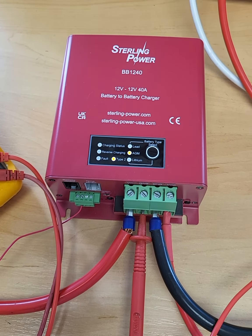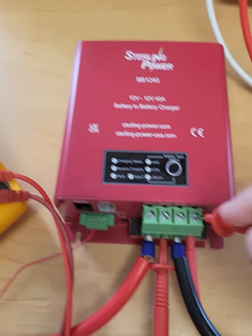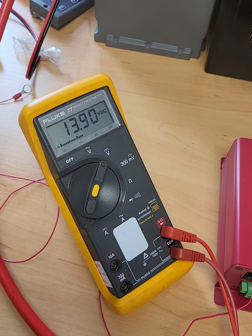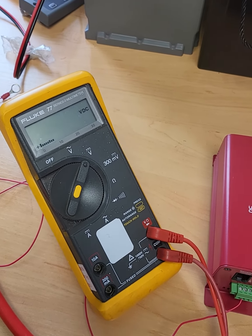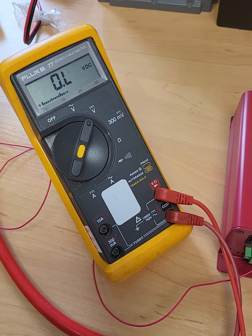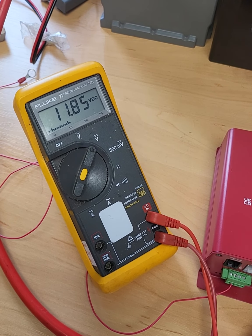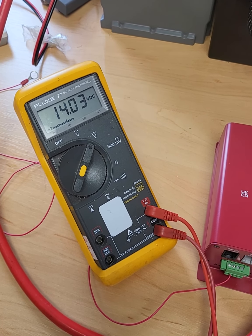Now what I'm going to do is show you what the leisure battery voltage is, which is 13.6V. If I then turn on, say, solar power or wind or something onto my leisure battery, the voltage is now creeping up to 14V. So I've got an alternative charging device on my leisure battery. My start battery I've just put a little load on to bring it down, just to exaggerate for effect. So my start battery is pretty unhealthy at 11.8V, but my leisure battery is up at 14V, so there's lots of surplus there.